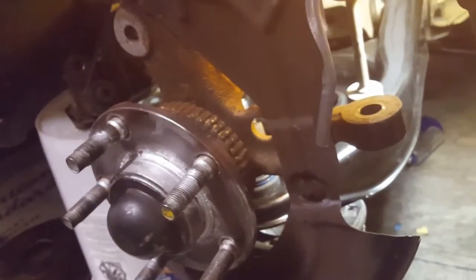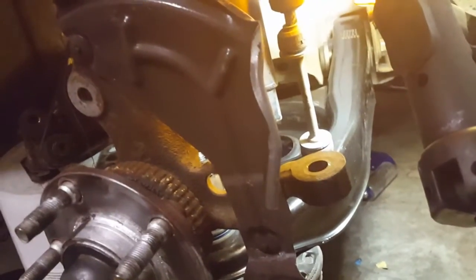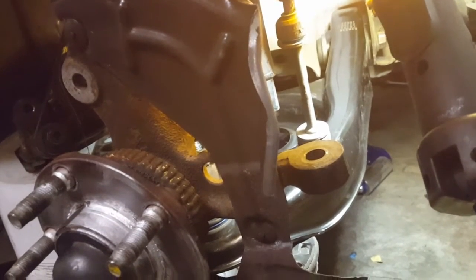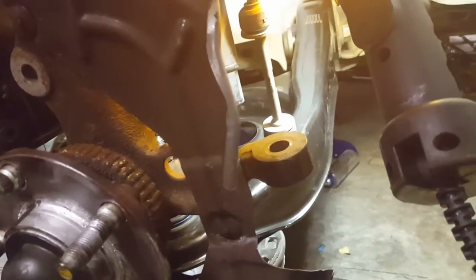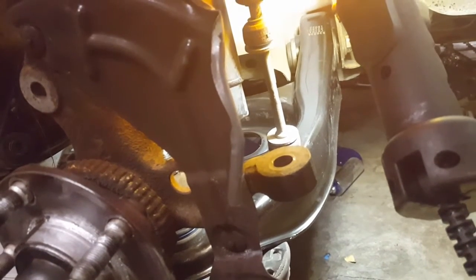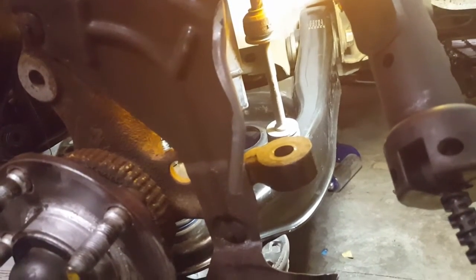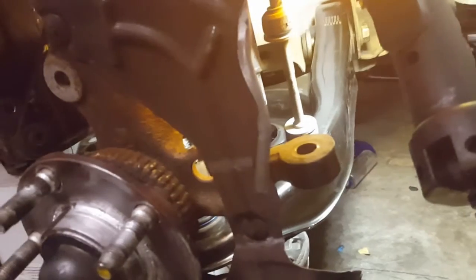We got the new outer tie rods. We're going to make sure we turn them in the same amount, and make sure these axle hubs are as straight as possible so that we can be pretty much straight, and then reconnect everything, the steering shaft, and put the pinch bolt back in. Like I said, we can also put in the new copper lines that go in the high pressure hose and the return line, and then we can fill the power steering pump with fluid and just let it sit there with the fluid in it. We don't have to fill it up. We can do that later.